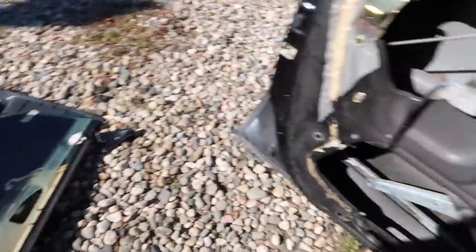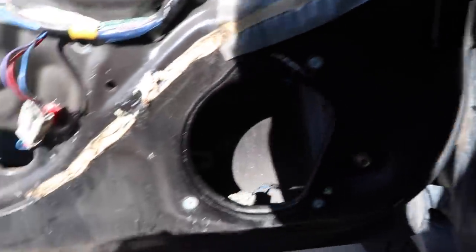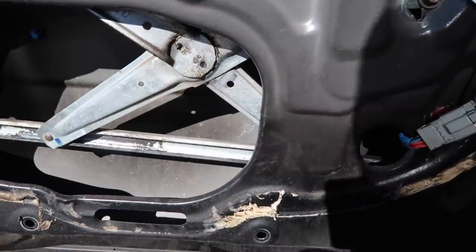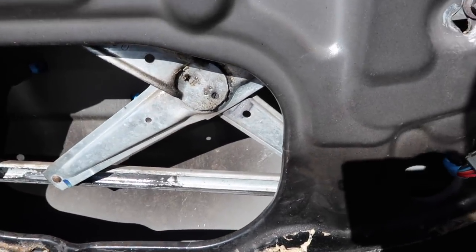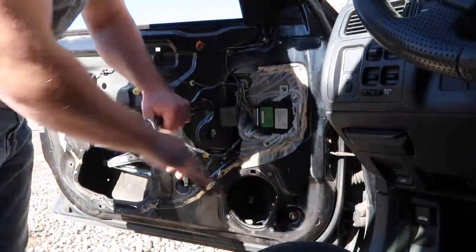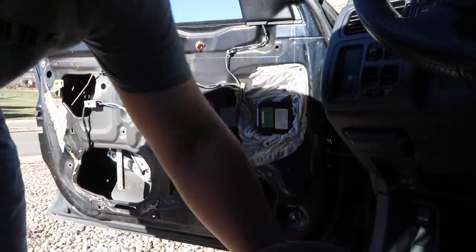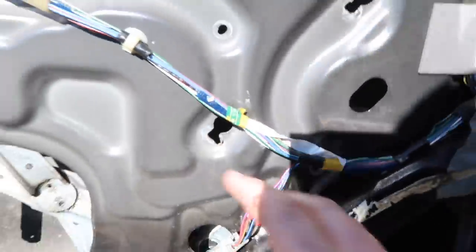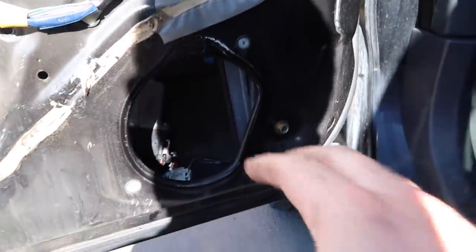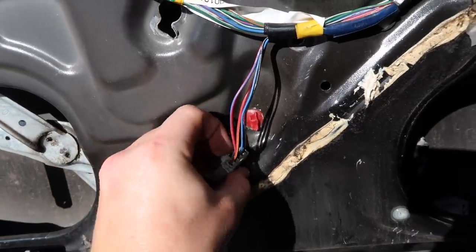Got the window out - lay it on top of the door panel. Now what you're gonna want to do is take all these 10 mils loose that hold in the regulator. There's one down here also. It's kind of a pain in the ass to take this thing out. You're gonna want it basically collapsed or folded in as much as possible. I'm gonna roll it up to where it's very compact so I can take it out, then break all these bolts loose. There's only four bolts - these ones are just the little guides for the window. Now this thing is basically loose, so you need to unplug it right here, and then take it out.